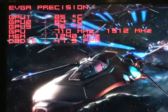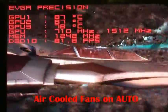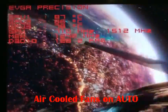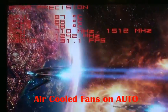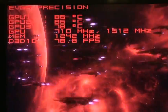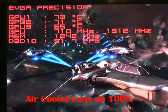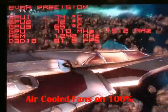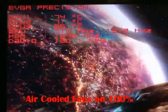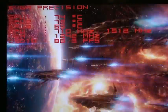We've been benchmarking for in excess of two hours on air. With fans running on automatic, temperatures were 87, 87, 78 — nothing near what you saw in the last couple of videos where a card burnt up, but there's still potential there. With fans on 100%, temperatures dropped to 72, 70, 64 — significantly lower, obviously. But if you've run the fan at 100% on these cards, you'll probably have earplugs in by now. Those fans absolutely howl at you.